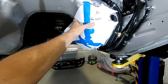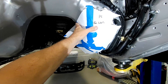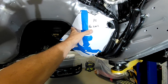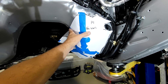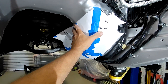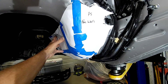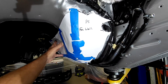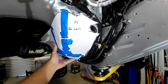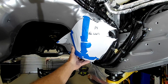The reason is I have an adhesive-backed aluminium and fibreglass heat shielding material, very similar to the plain aluminium stuff I used in other areas. You can shape it to a certain extent, but you can't expect it to do ridiculous things, so when getting around a shape like this you will need to make some cuts. Part of the reason I made these templates was so I knew how much material I'd need to buy.